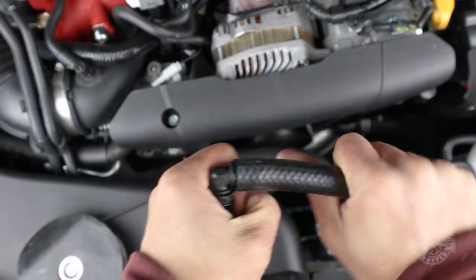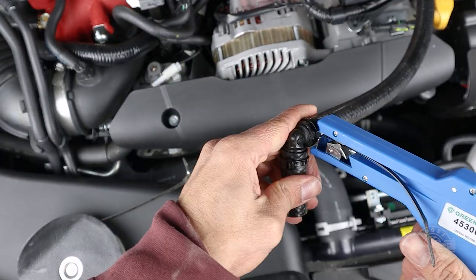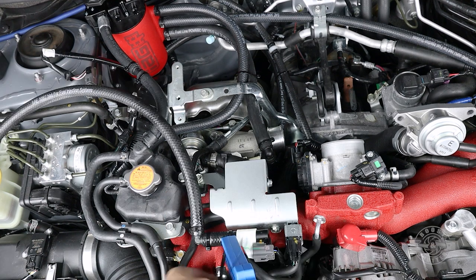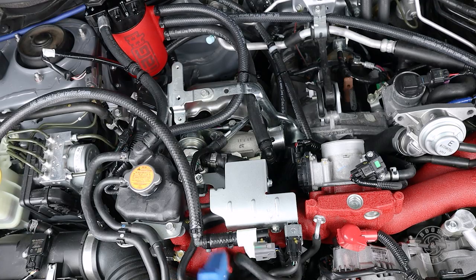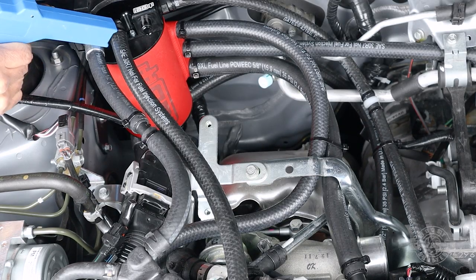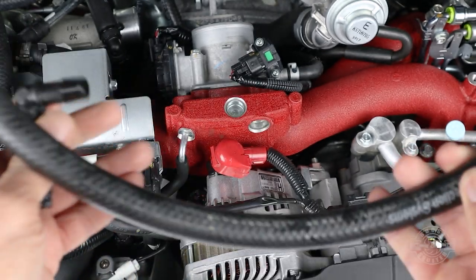Put one fitting assembly aside for now, then grab the rest of the hose and connect it to one of the 90-degree fittings. This hose is routing left, so use the natural bend of the hose that way. Grab a zip tie to fully secure the hose on the barb. Take that hose and install it onto the sensor we just put back in the car, secure with an included zip tie, then cut to size so it goes into the top center port. Finish with a zip tie.